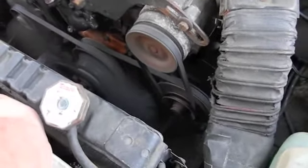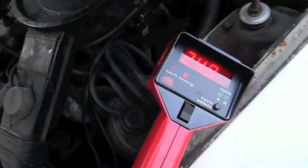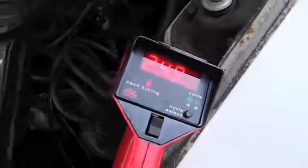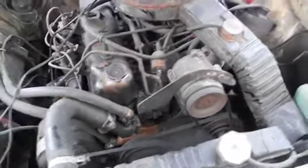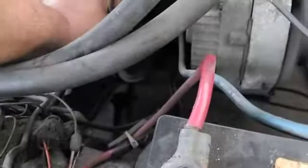I'm going to take it back and see what my total mechanical advance is. With the initial advance of about 15 degrees, I'm getting maybe 12 degrees of mechanical advance, and 25 degrees mechanical advance total — that's not too far off. I want to understand everything on the distributor. They'll calibrate it to 12 degrees, and when you load the motor you get the engine holding back. I just can't do all that — put the vacuum hose on and all that stuff — but now I know everything's working.